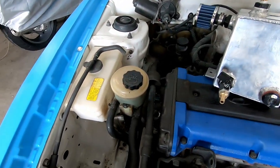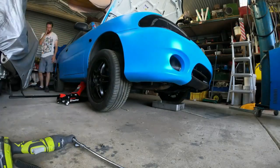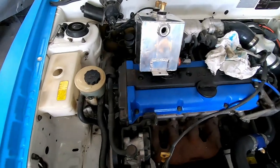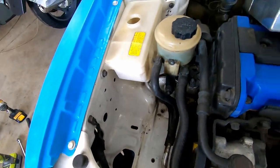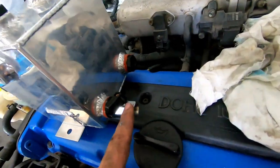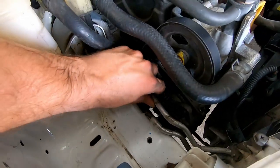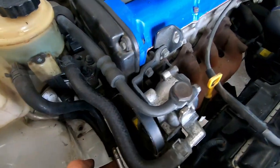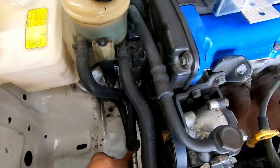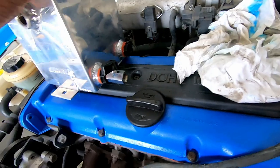So what we'll do is we'll take this out and then we'll try and fit that in there. So here's where we're at — it's a very tight spot, but I think I've figured it out. I've just taken the filters off for now and I can fit it in there. The only thing that's stopping it is we've got the drain and the bung and that interferes with the power steering line. So what I'm going to do is bend the top line up a little bit and just shorten this hose so it doesn't put stress on the bottle — and that'll sit above.